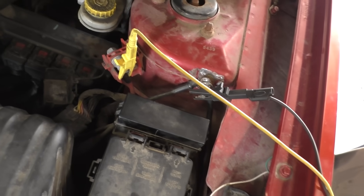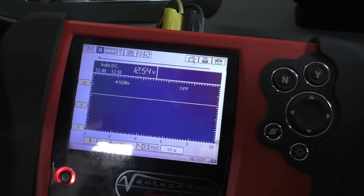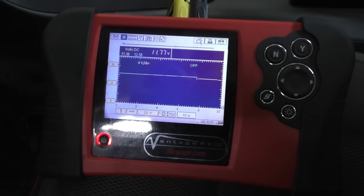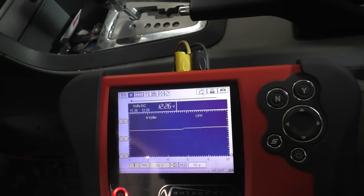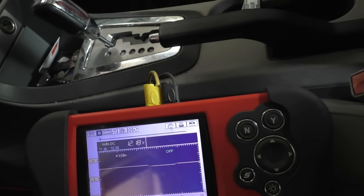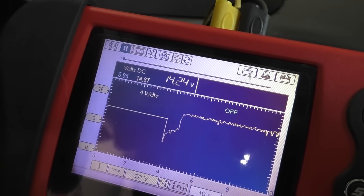For our first check we're going to leave our leads hooked up with the positive lead and the negative lead. This car has the battery down in the fender liner, so we need to make a lot of our checks right here. Initially let's just turn on the headlights — I turned on the high beams, that's the only thing on, and it dropped down to a minimum value of 11.4 volts, holding about 11.7. Headlights back off, key on drops down to 11.8. I'm going to go ahead and crank it — look at that, minimum voltage 5.9 volts it dropped down to.